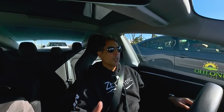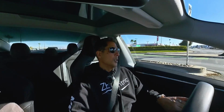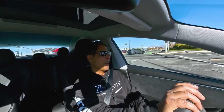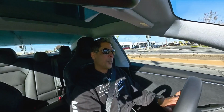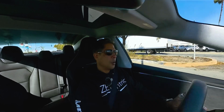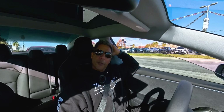This car is a little bit different than other ones we've done, where the front was at 380 and the rear was around 390 hub to fender, 385 to 390. So we are a little bit on the lower side. I was expecting this car to end up around 360 to 365 millimeters hub to fender. And we are in standard mode for ride and handling.